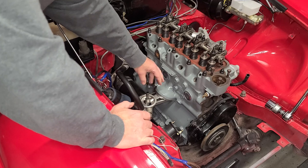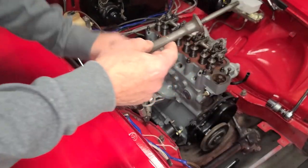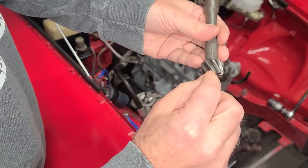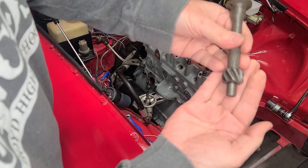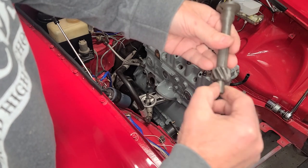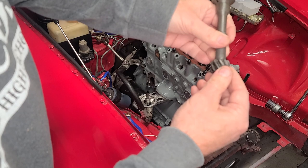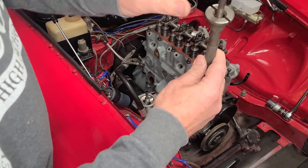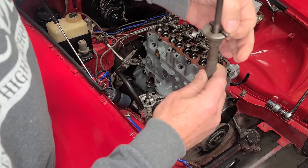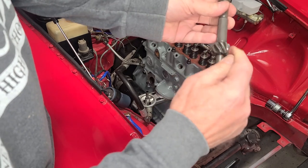The spindle has a number of bearing surfaces. This bearing surface right here is what goes down into and runs in a little bearing in there, so you want to make sure you get some assembly oil on there. This is the gear that actually runs on the camshaft, so you want to get some assembly oil on there as well. When you put the distributor on, you're going to want to put some assembly oil in here too because the retaining housing goes on top to keep it in place. Assembly oil here, here, and here.